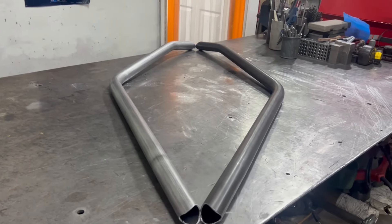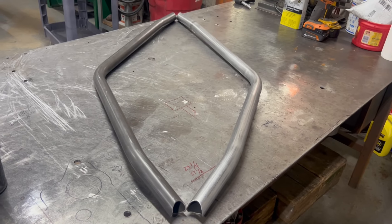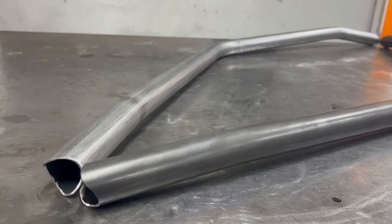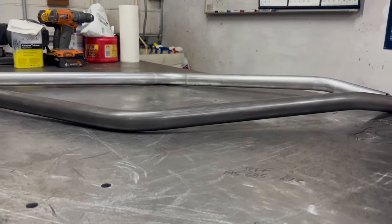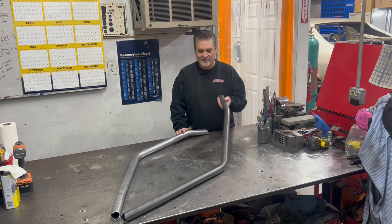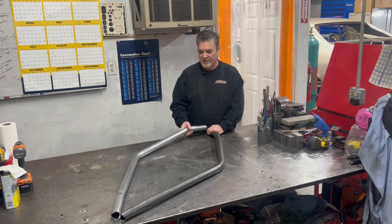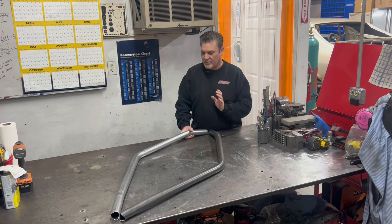I've got these here and I'm going to show them to you — I'm actually going to bring the camera down so you can see how symmetrical these are. I mean, these are absolutely perfect. I've been bending these tubes for years and I can't even count how many roll cages I've done. Also, on all the roll cages we do, we sand every tube before we even put it in the car — we fit them, sand them, then put them in. So when it comes time to paint, it's minimal scuffing and they're ready to shoot. It's extra time but it's well worth it in the end.